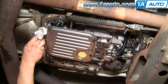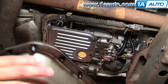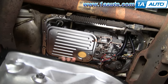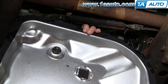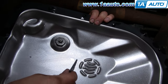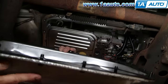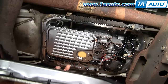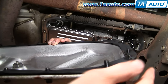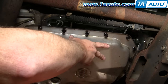Now take a cloth and wipe around the edge of the transmission — you don't have to wipe down inside, just around the edge. Here's the pan — I've cleaned it all up. One thing you want to make sure you do: there's a square magnet in the pan — at least take that off and wipe it down. I've cleaned the pan, got my gasket on, put four bolts all the way through, and the rest of the bolts just fed through a little bit. Now I can put my pan up and in.